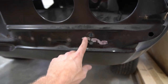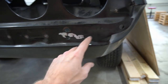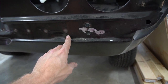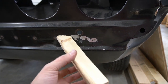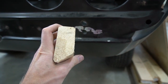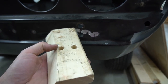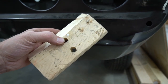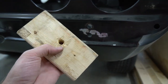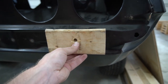The first thing we're going to do is make the standoffs, which will allow us to come out past the body lines and corners. To do that, we're going to cut some pieces 2½ inches by 6. We've got 2½ inches this way and then 45 that to get up above this body line. Instead of just cutting it down 2½, by 45-ing it we get a lot more material up top. So it kind of just sits like that, and then the 2x6 will sit on that.